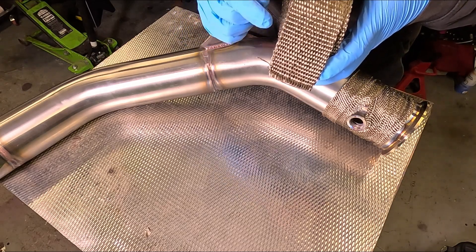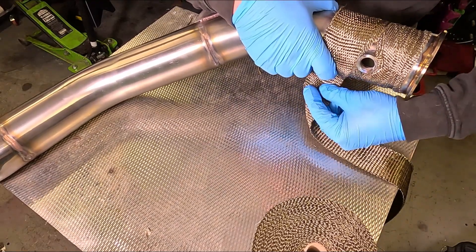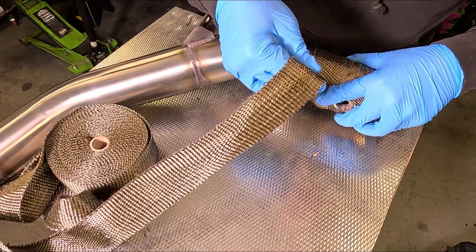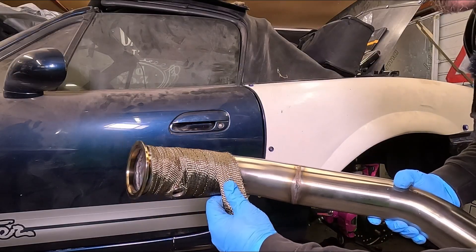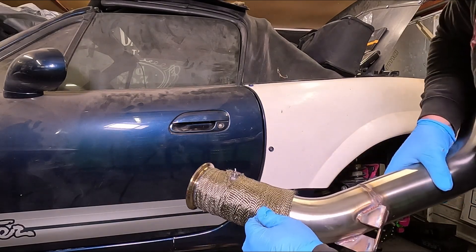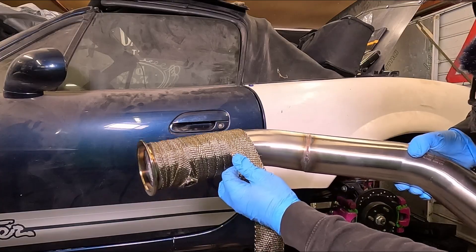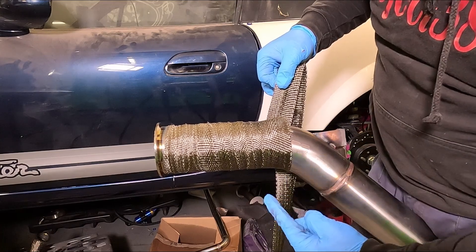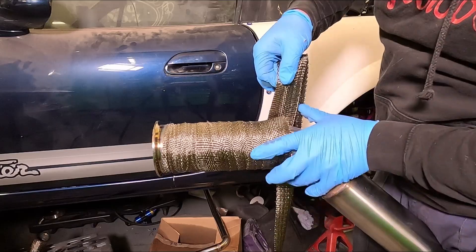It squishes this down a bit and it looks a lot neater. To start the first wrap off, wrap it around and if you get it tight enough you shouldn't actually need to use a cable tie to secure it down. Then carry on from there overlapping at least 50% on the way up. You don't have to keep too much tension on it as it will deform the wrap a little bit, but just apply a little tension as you go around to keep it nice and neat. Try and keep the overlaps as uniform as possible. It's going to get a little bit different once it comes to the bend as it will be overlapping a lot more on the inside of the bend than the outside — just try and keep it as neat as possible.